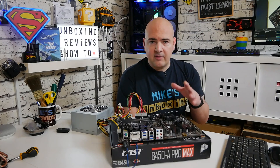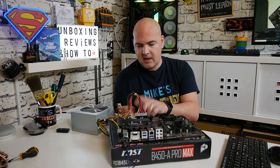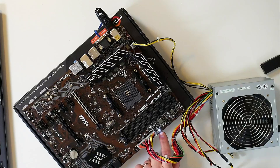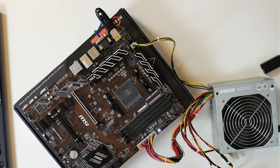The LED has turned off and the power supply power cycled, and we're back to the CPU debug LED being on CPU. The light's gone off on the flash side now, so I think we're pretty much done. The BIOS flashing section is all done.